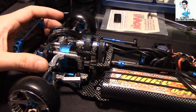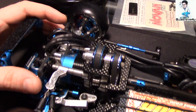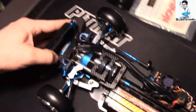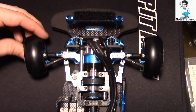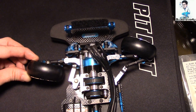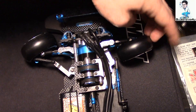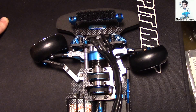Let's take a look at my steering lock. So here's static — right now I've got about 1 degree toe out — and I'm going to go full lock. There we go; about 75 degrees. And the other side — that's 75 degrees right there with almost parallel lock.